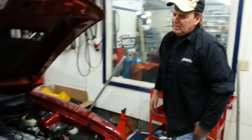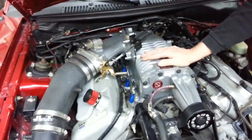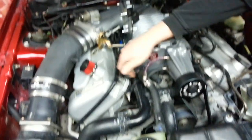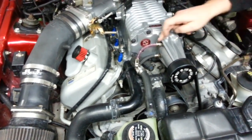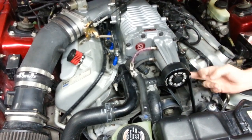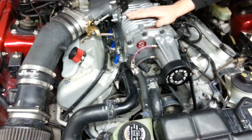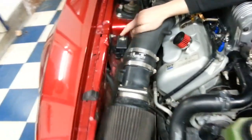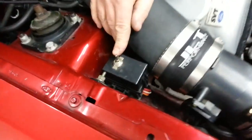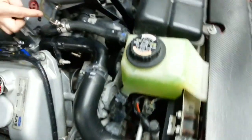This one also has what we call a Venom Cooler. And what I do with the Venom Cooler is I'm running liquid off the intercooler system, and it's running through the front drive, past the bearing, and it's flooding the outside of the casting here. Works just on the principle of an engine block. So when this is running, get a good look at it. I'll turn it on. This car actually has a remote switch for, I guess, cool downs. Bam, you see the water, bam, comes right through here, circulates through.